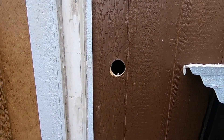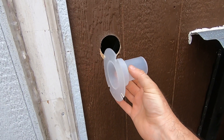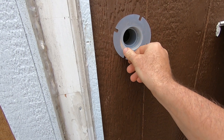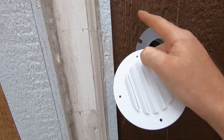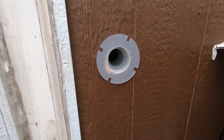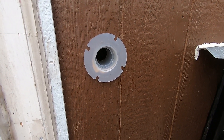So you drill a hole, this goes in, and that hose hooks up to it, goes in the wall, and you get a vent cover. Put RTV all around that, and the wet batteries vent to the outside. It doesn't get any easier than that.